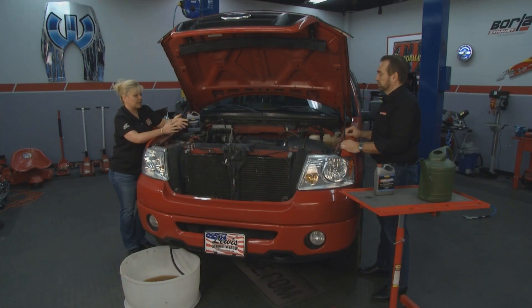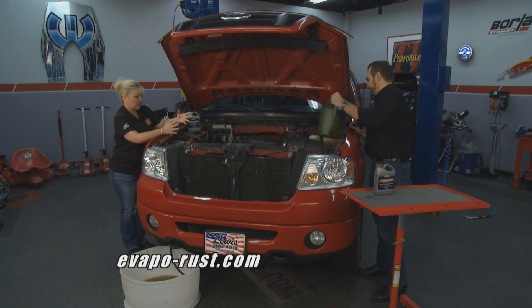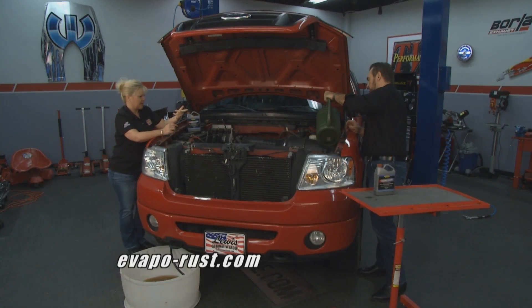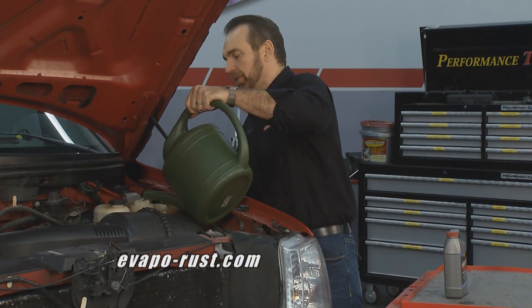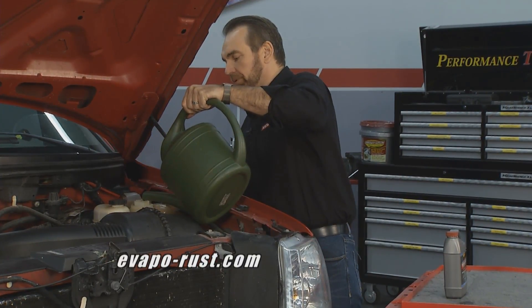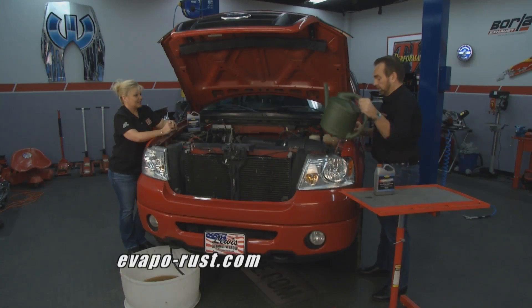Some things we want to keep in mind when we're doing all of this — make sure we don't have any air pockets when we get all done, because that can definitely mess up your gauges when you're going down the road. Will we put in about a couple of gallons of water? Yeah, it's going to be about a couple. It depends on each cooling system — it'll be a little bit different — but just fill it up to the recommended area. The difference in water amount is not going to be a big difference to Thermocure.